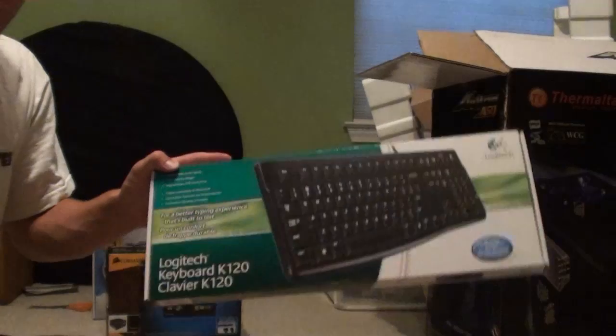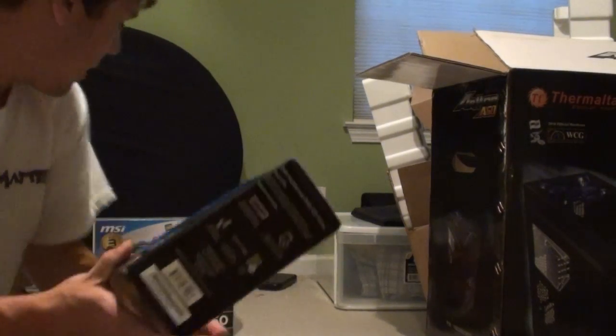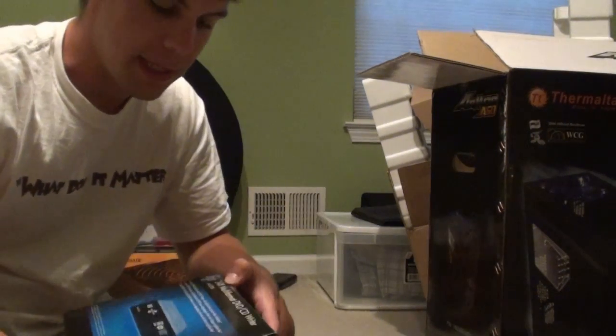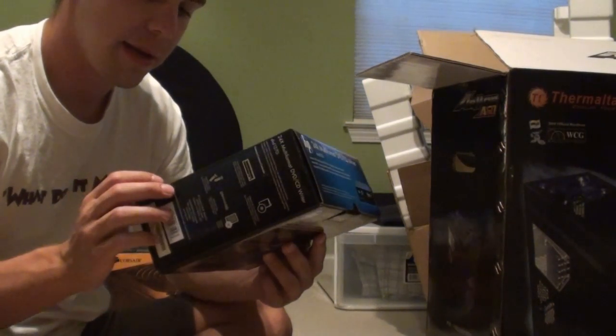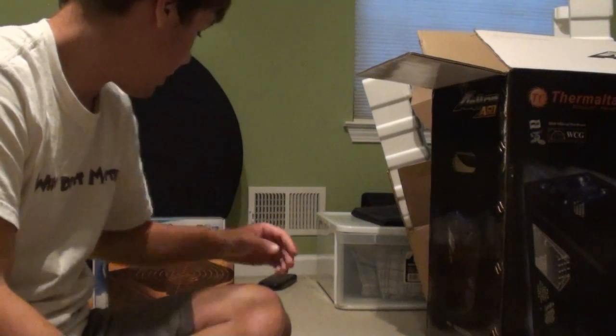There's also a K120 keyboard, not that you'd really care. I'm probably going to upgrade to Blu-ray later this year. I originally was going to use my old drive from my old computer, but I realized it uses an IDE cord, which is pretty much obsolete at this point. So I had to go to Best Buy and buy a SATA DVD drive — a bit overpriced at $40. You can probably find the same one on Newegg for like $20. It's a 24X multi-format DVD standard burner. Blu-ray burner drives internally are only about $30 more, so I'll probably get that later this year.